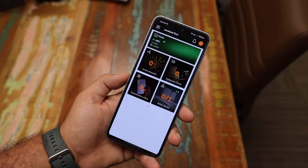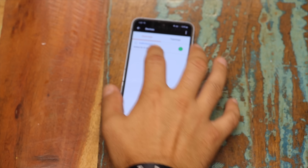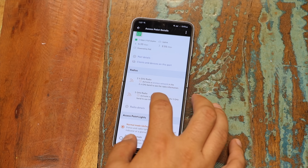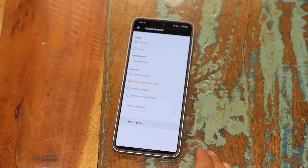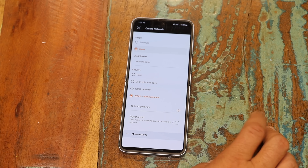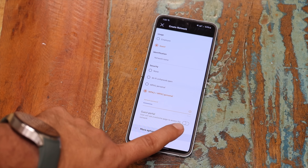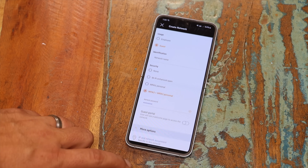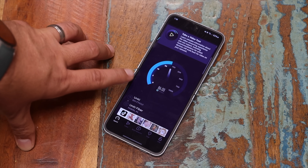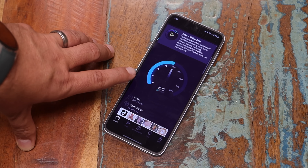It's an access point, and we're connected and ready to go. This did take an update and is now completely online. We'll select it and then select the device. Down here, we can set up a wireless 2.4 GHz or a wireless 5 GHz network. We'll go ahead and add a network — we can make this for employees or guests. I'll make it for guests, and we can put a network password on here. You even have the option to set up a guest portal webpage that guests will see when they access it. I'm connected to the new network and getting our full speed on the speed test.